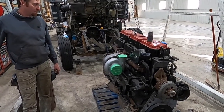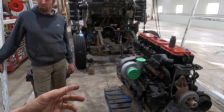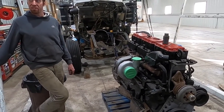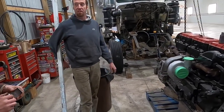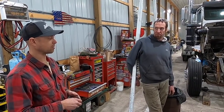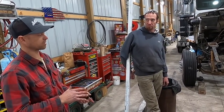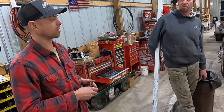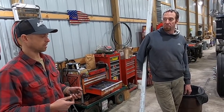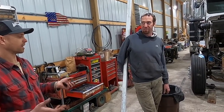Because originally it wasn't a 500 horsepower. It was originally a 370. Set at 330, I think. And you can do that just in the ECM? Actually, we had to change injectors. The cam, we were able to stay with the original cam from the original motor. It was within spec to run as a redhead cam. But we had to change injectors and turbo, and it doesn't take much. That's about it. And ECM.